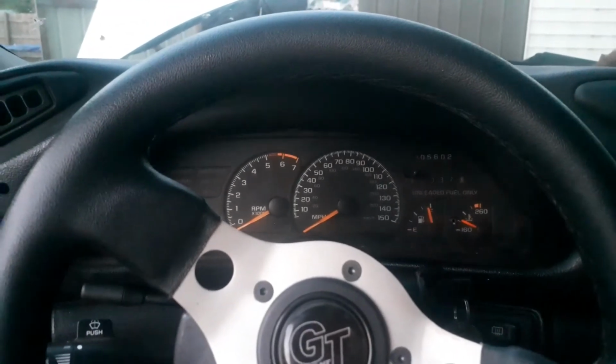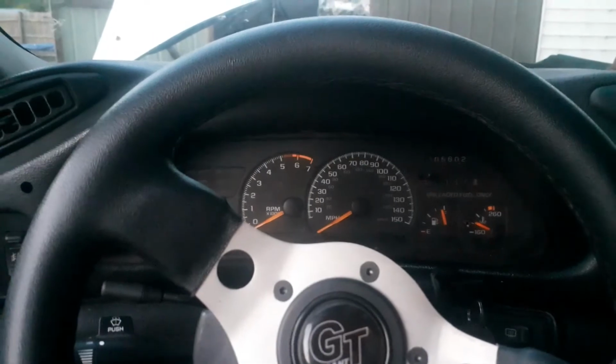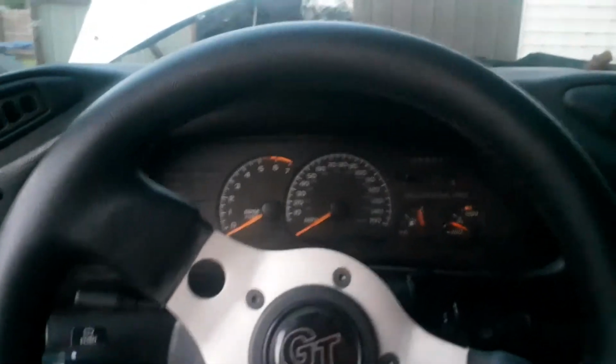Yeah, a trans brake. I'll probably stick with the forward shift pattern, but I am gonna get a manual valve body, trans brake, and I'm gonna get a 4000 stall converter. Because that's what Chris is running on his. He had a looser stall converter in it, and on the nitrous, it made it go faster on motor, and on the nitrous it didn't hurt the times.